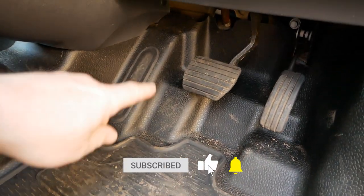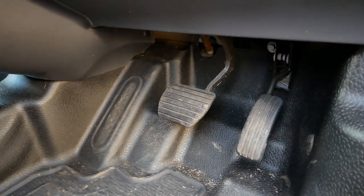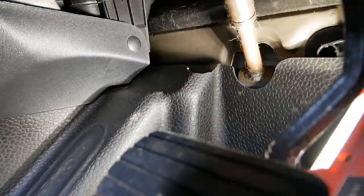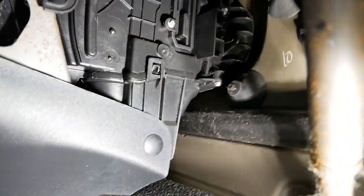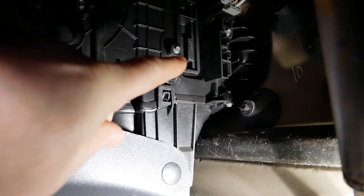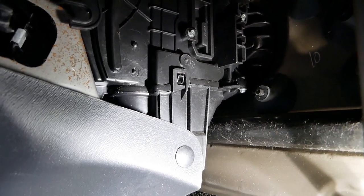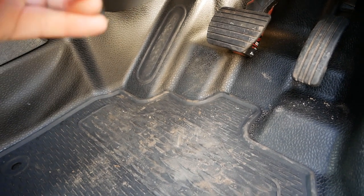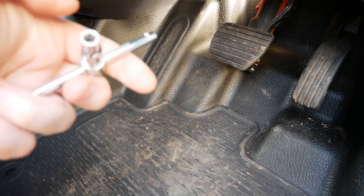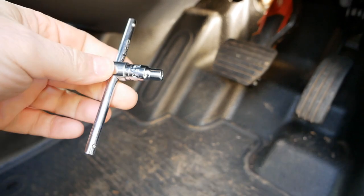In this case this is an electric van so you don't have a clutch pedal, so it's a little bit easier still, but it's up under there. If I shine the torch up near the steering column I can just make that out there. You can see there's the little door and that screw has to be removed and then this flap removed. For that you need a 5.5mm socket or a spanner — that's what you need to remove that screw.